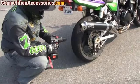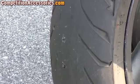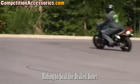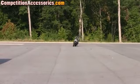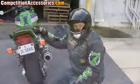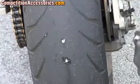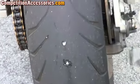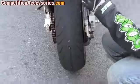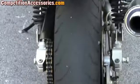The nails didn't do the trick — let's see if a drill does. We've run six nails through the tire and actually drilled two holes in it. It did leak some air when the tire was still, but as soon as I started riding, the sealant came out and plugged the holes. You can see some of it sprayed up, but it is water soluble so we can wash that off easily. It has actually sealed the tire — you can see the holes where it punctured multiple times.